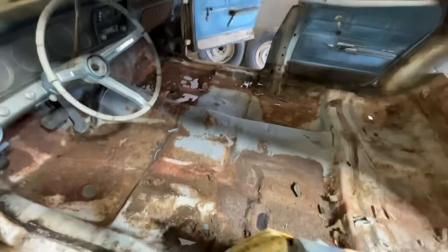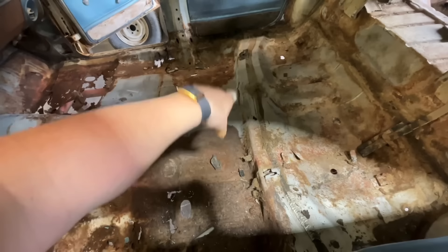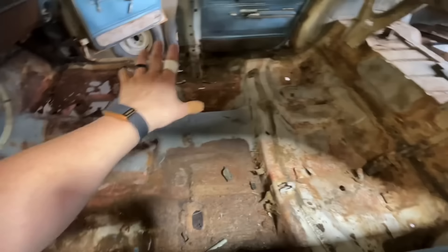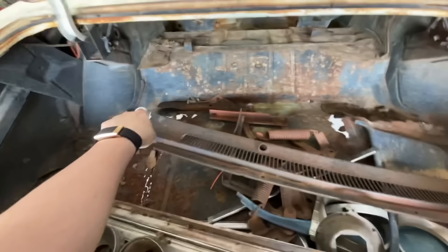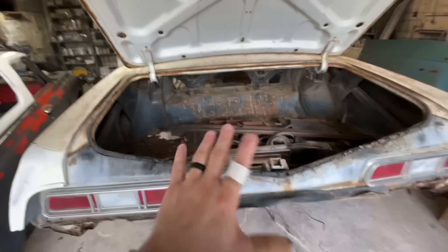I don't want to do cross bracing before we get it on the chassis. The good news is the frame we have, if it's narrow enough, will fit just on the inside. I'm going to use that as a line to cut. The front is shot, so I'm gonna cut straight across right there. I'd love to keep that floor section if I can — I don't know if it'll work with our frame. I'll probably just go ahead and cut out the whole trunk too. That hump in the floor is a lot of strength and I'd love to leave that intact if possible.